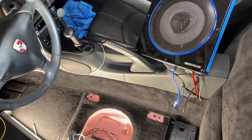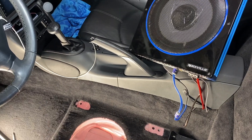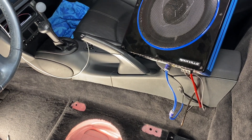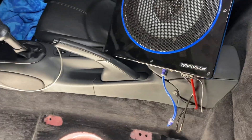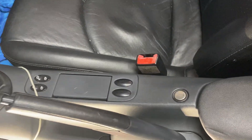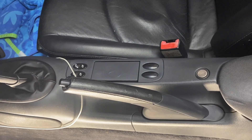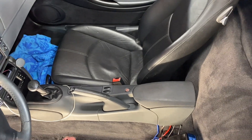I just have my sub pulled out from behind the seat and out of the way so I could get the seat out. The next step I'm going to do is remove the center console — I happen to have a video on how to do that. I need to get this center console out because these are the blanks where we're going to put our switches, and I have to figure out where underneath to connect the wire that goes from the switch to a source that illuminates it when you turn the headlights on.